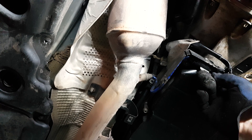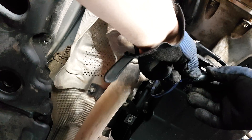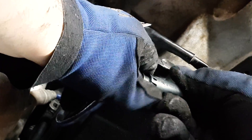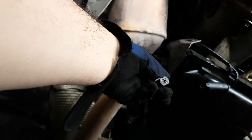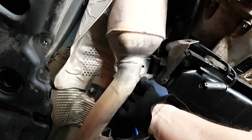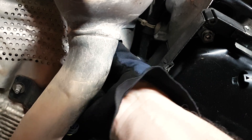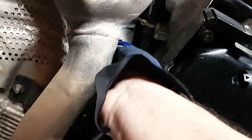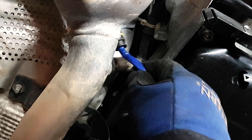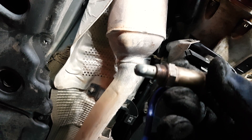There's just not enough room. To torque it, you could get a 22-millimeter crow's foot wrench, but I'm torquing it by hand and I'll show you in a second. You'll have to remove the electrical connector just by pulling it out and then turning it left. You'll have to play with the cable a couple of times as you're turning it, as it will come in the way of turning the sensor. This one wasn't changed for 23 years.